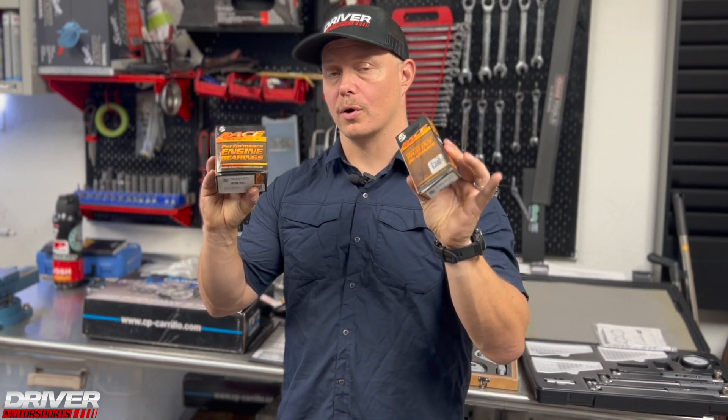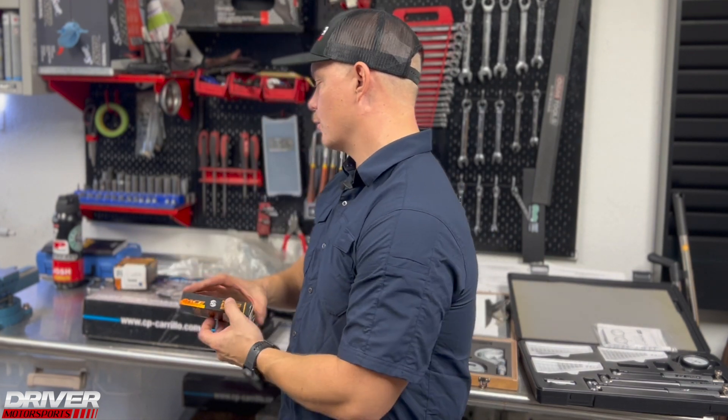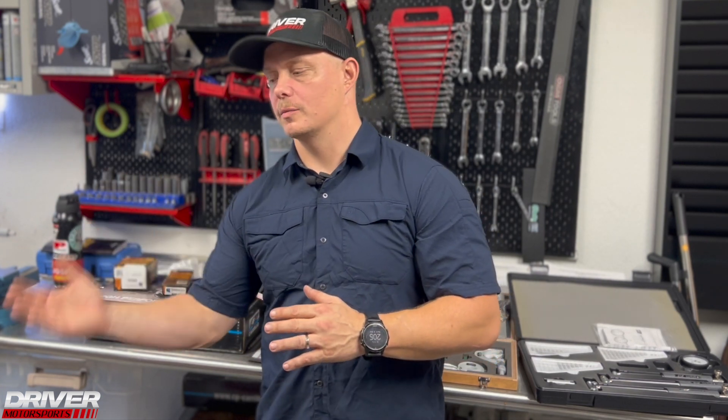Starting with quality parts makes your life easier. If using the dial bore gauge, I measure different cylinders to make sure piston fit is proper, and I write all of that down. For all the rotating assembly bearing clearances, I write that down too. Everything gets documented.